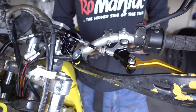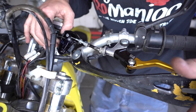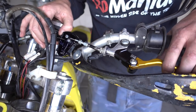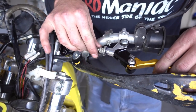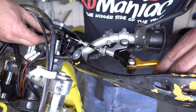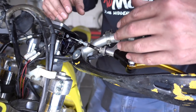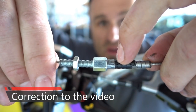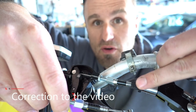This is the value on my channel — the hidden side of the truth. On Vegas Romaniac, you're going to see videos where everything is working, but also the truth. The truth is that it's quite hard to make this one work. I'm at a stage where the clutch is not pulling long enough — I have a little bit of a gap and I have to make this go further. Also, this piece doesn't fit through this fitting because it's a thicker piece of wire than the original clutch cable. I'll have to figure out a way to make it go through. I was thinking inside the box instead of outside the box — there's a little cap at the end which I ground off because it wasn't fitting into the fitting for the clutch lever on the DRZ.